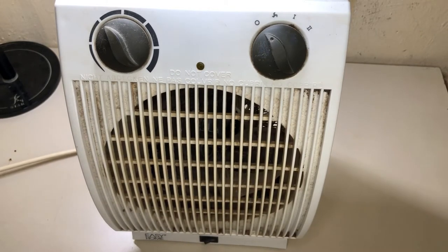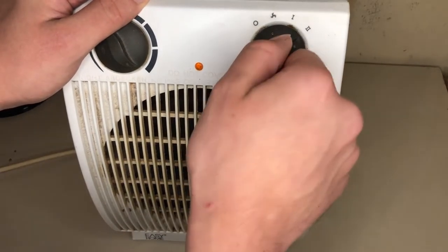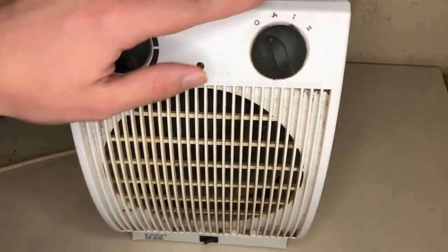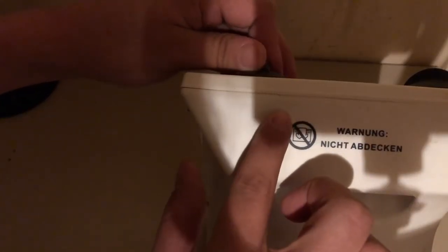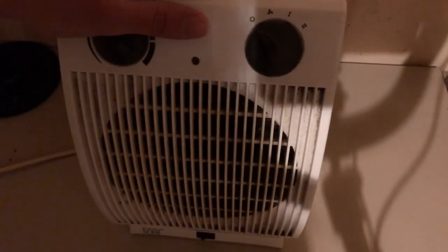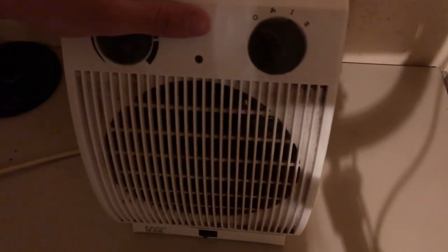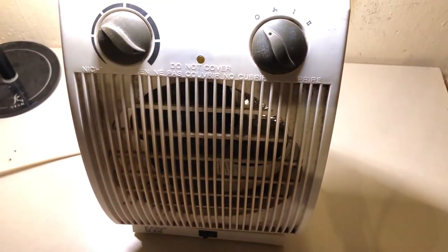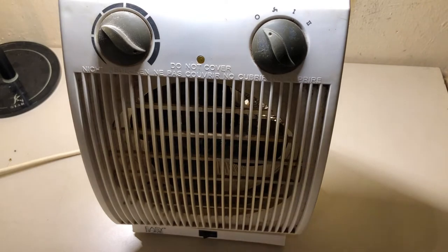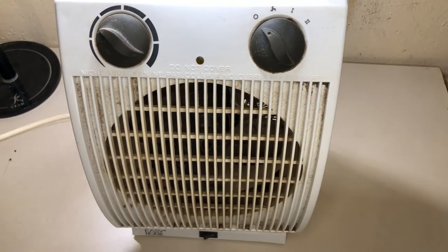So, second problem, I'm going to turn up this light, and you can see it. It's too much light, hold on. In this area, I can clearly see a spark, just from using the switch. So basically, it needs a cleaning around there. Seems like a contact has some oxidization on it. And it also draws a lot of current, because the cable often gets pretty warm.